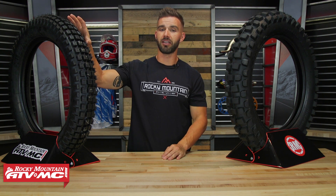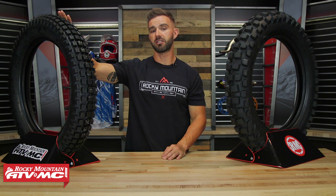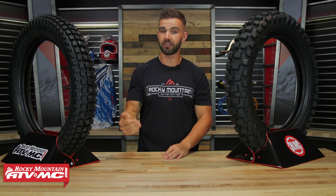Now with the trials tire, there are going to be a few trade-offs. If you're a more aggressive rider, you're probably going to notice that it's not going to grip, or it's not going to corner and brake as well. And also with that softer sidewall, they are going to be a little bit more prone to pinch flats.